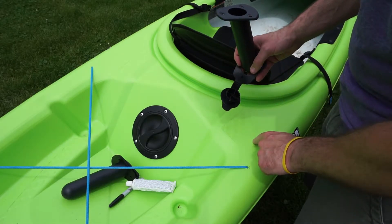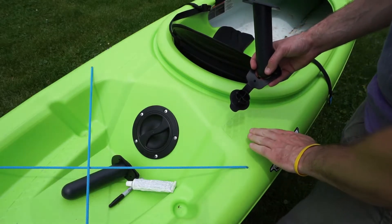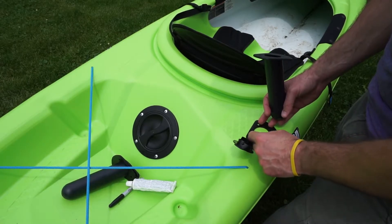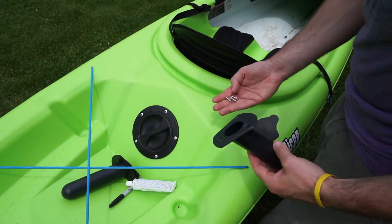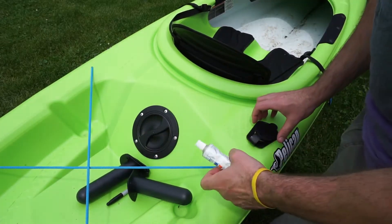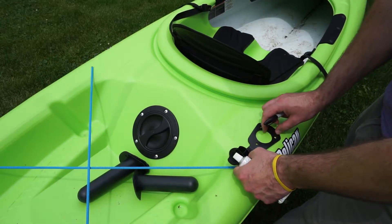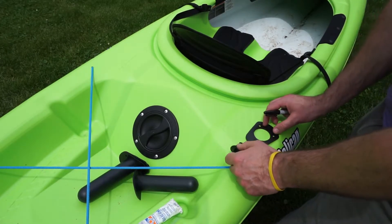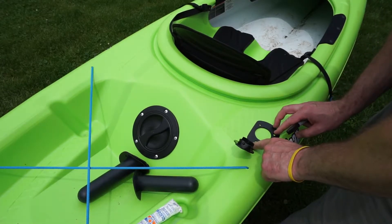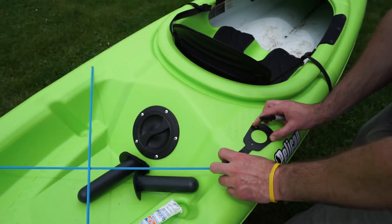Normally I would use a well nut, but because this has a gasket, the well nut has a little bit of a lip that will stick above the surface. So I want to silicone this gasket down so that no water will leak in, and I'll just be using regular stainless steel screws. You're going to need some silicone, a sharpie, and something to cut this out — a jigsaw or whatever you have. I'm going to eyeball both sides for placement, trace it with the sharpie, and then cut them out.